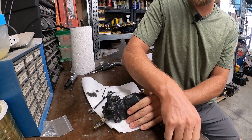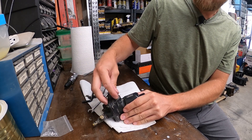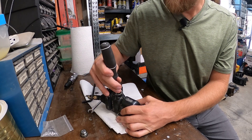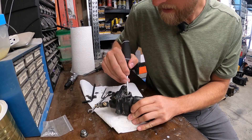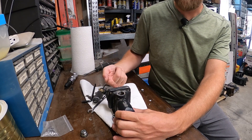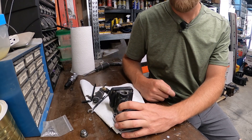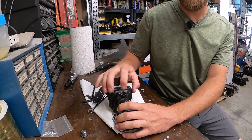The other adjustment we're going to play with is under this cap - it is the star wheel, which takes an eight millimeter Allen key. You just unscrew this cap - be careful, there's a metal washer in there. Inside there is a wheel with basically ridges on it, and you can put a screwdriver in there and turn it and you'll hear it click. If you rotate it counterclockwise as you're coming from the back side, it's going to pull that star wheel this way, which puts more preload on the AFC spring. If you push it the other way, it's going to have less preload on the AFC spring. This controls your fueling from about five to thirty pounds of boost - so when you're in boost, this is how it's going to fuel.